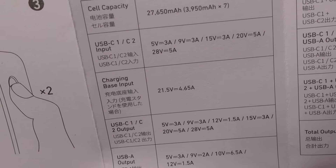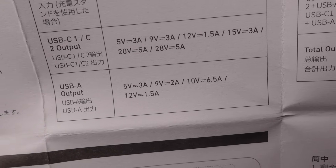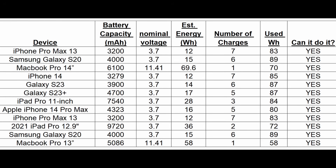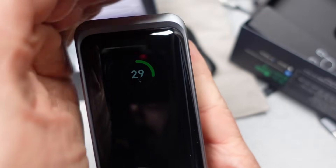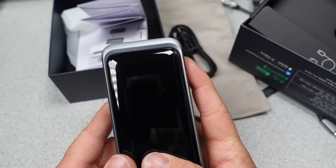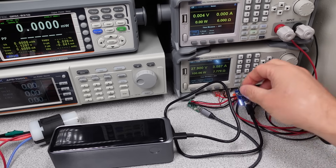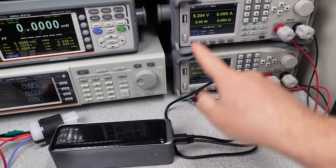The user manual for this is not bad — it gives simplified specifications and is easy to understand. They do mention the double push to enable low power mode, but I still can't get it to turn off. Here is a chart of devices showing how many times it can charge each — with the energy in this device, it should be able to charge all of them at maximum speed. The power bank charges very quickly; it will full charge at 140 watts for nearly its entire charge cycle — at 140 watts it only takes one hour, and at 100 watts it takes one hour and 24 minutes. In 140-watt mode it tapers for about 20 minutes, but this one also has the issue where the display shows 100% long before charging is done. The screen charge percentage on this device is extremely inaccurate — I also saw this on the 200-watt Anker power bank. It's like they forgot how batteries work.